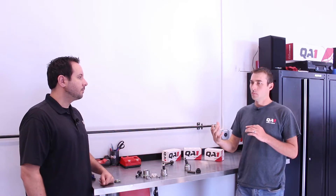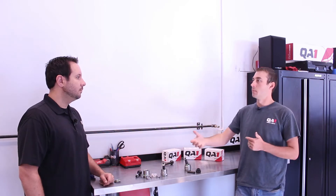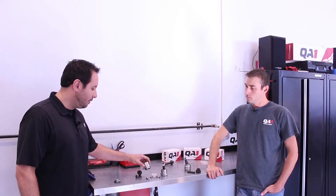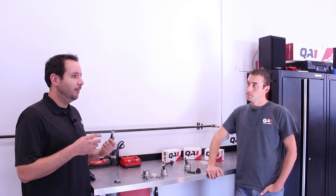With that design, a racer can do maintenance at the track and even some tuning with different pins. As someone who has a dirt late model and races most every weekend, at a racetrack if you end up having trouble, you need to fix it quickly and efficiently. One cool thing about the QA1 design is you can pop the stud out of the housing without taking the housing out of your control arm, which is especially helpful if you have a press-in into a stock lower control arm.